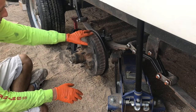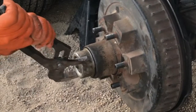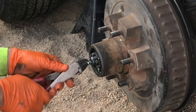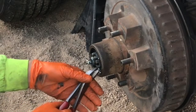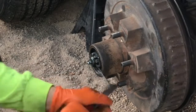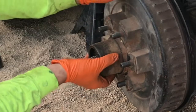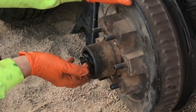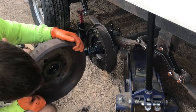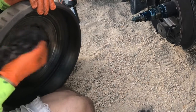I'm starting to put the tires and wheels on after tightening all the U-bolts down. However, I was worried about rocks getting in on the brake shoes since I had to drag them through the gravel. So we're going to go ahead and pull the drums off and check the wheel bearing adjustment. A large pair of channel locks works best to get the grease cap off — if not, a hammer and screwdriver will do. Depending on your trailer, it might have a cotter pin or a spring-loaded cap that goes over the nut. Either way you're going to have a device that locks the nut from walking off. The best tool to remove the cotter pin is a pair of dykes, leveraged against the outer housing of the hub. These should not be any more than hand tight for your adjustment. Cradle the wheel bearing as you pull the drum off and catch the wheel bearing and washer. There were a couple rocks and debris in the drums from pulling the axles through the gravel, so went ahead and cleaned that all out.